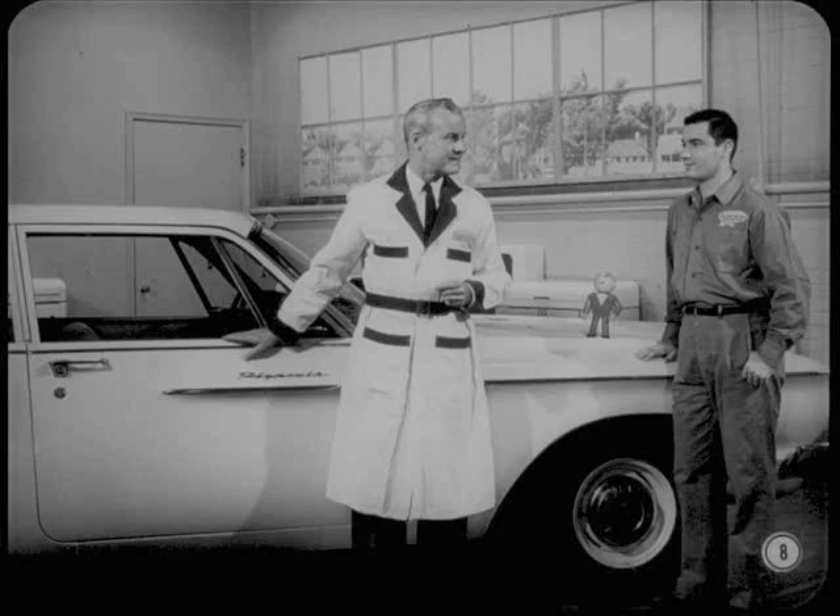Where do we start? I think the front door on this Plymouth two-door sedan is as good as any. What we cover on this door applies equally well to the front doors on four-door sedans and Suburbans. These instructions also apply to comparable Dodge models. So let's start with the hinges. Although they're new, the adjustment procedure is about the same as on past models. They give you adjustments in or out, up or down, or fore or aft to get proper fit in the opening.